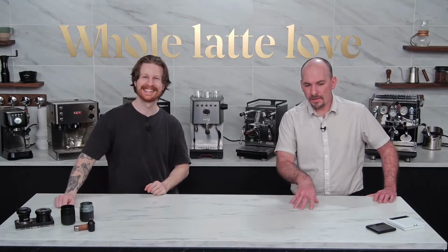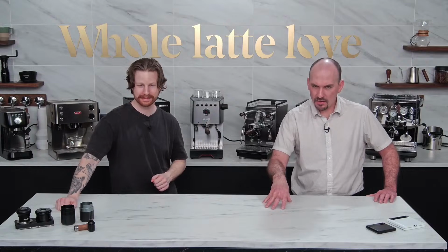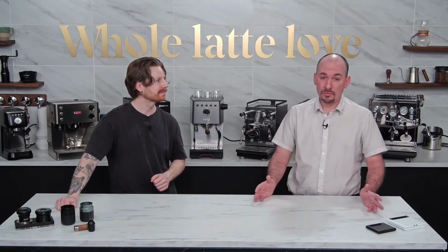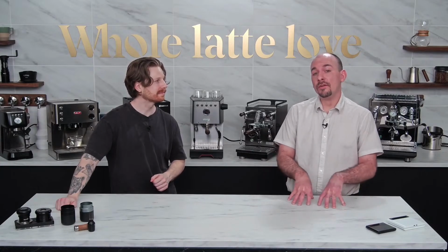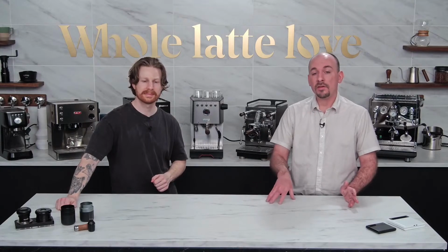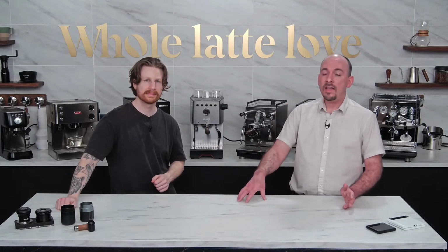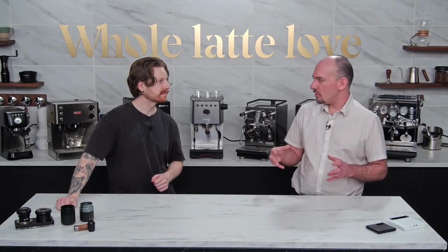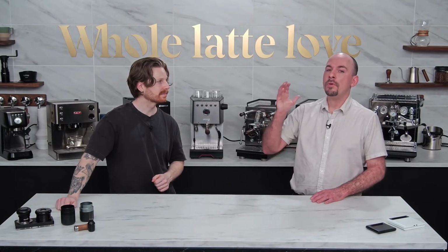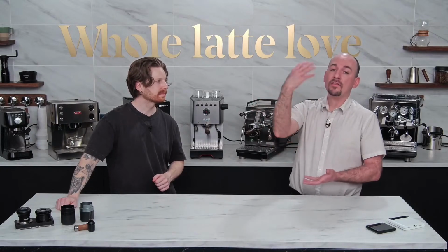So we've got a couple other questions from RJ. So RJ, I think, is asking about spring lever machines. So the truth is, I actually am not 100% sure. It is going to vary on models too. But the two that I have personal experience with are the Bezzera Strega and the Profitec Pro 800. So the Strega has a fairly small boiler. It's more like a heat exchanger. And then the pump actually does run at a low pressure to pump water out of the heat exchanger into the lever group, and then the spring begins.